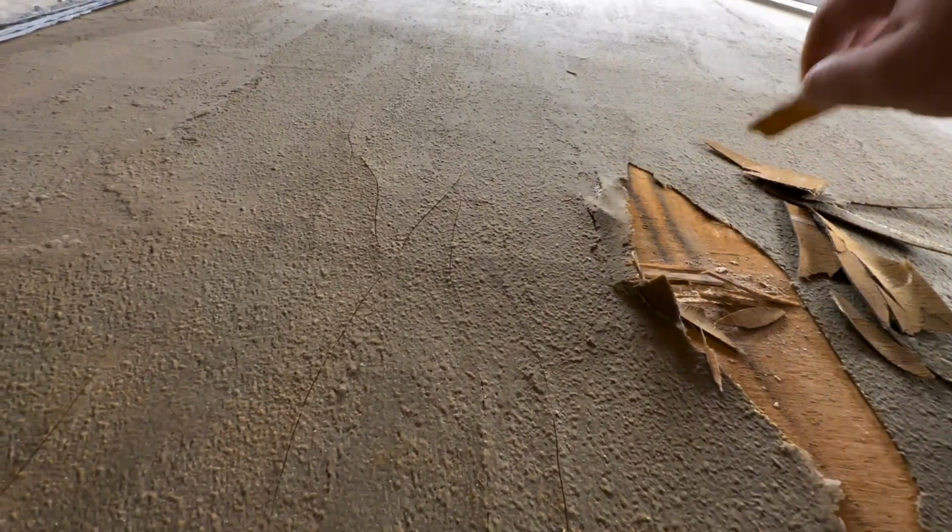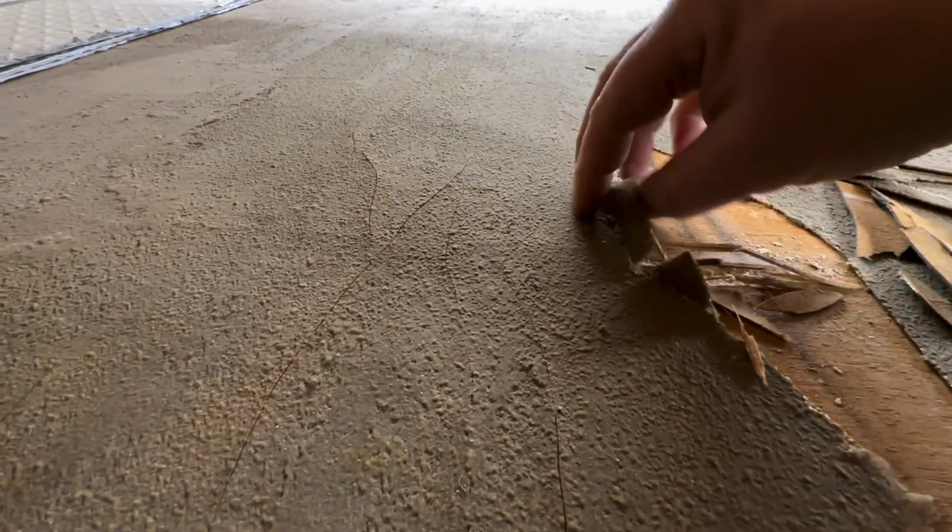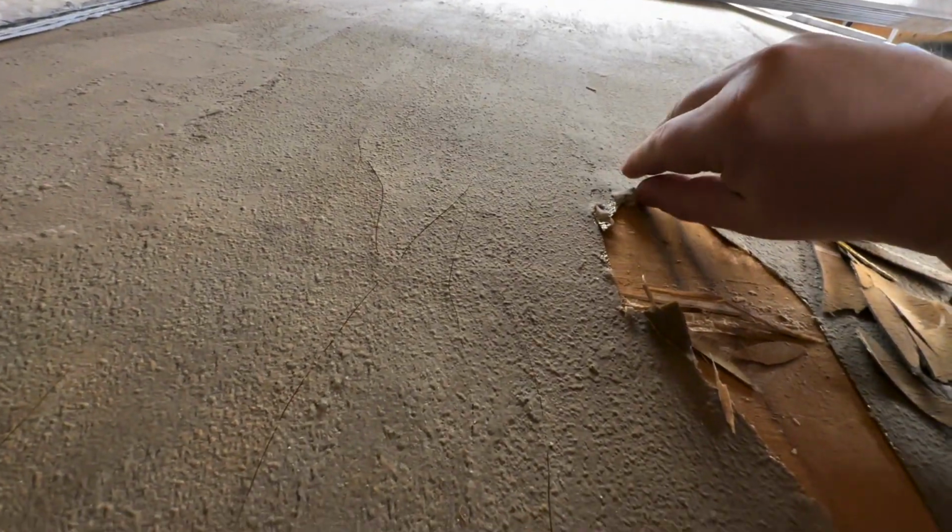Now, they originally thought that by putting a rubber roof on, you can see it right there, it would be a cure to their problem, but unfortunately, that's not the case. Don't get me wrong, the rubber roof was a great idea. The problem is, after a couple of years, it doesn't matter. The sun's beating down on the roof, the wood starts to dry out, starts to crack, moisture starts getting in, regardless if it's rubberized, and you have delamination, which is what we've got going on.